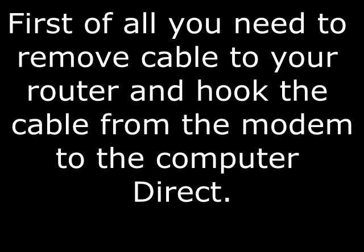You should turn off your computer and unplug the power to your modem and router. Once you've done that, take the wire that goes to your computer from your router and disconnect it. Then take the cable from your modem that went to your router and connect it to your computer directly. Once you've plugged the modem into your computer, plug the power into your modem and turn on your computer. You may or may not have internet service.